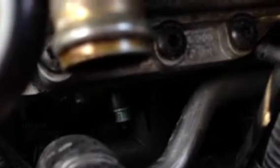Anyway, what you have to do is pull this stock hose out. Mine's still connected, I'm going to leave it in there. Your breather hose connects up top, so you have to slide this off. Slip this side off of the valve cover gasket, and then this pulls up off of this. So this is the one-piece tube that replaces the hard line. Keep in mind your stock hard line does bolt to the side of this head assembly right down here. See that naked bolt? Your hard pipe bolts to that, so when you pop off the bolt to take the hard pipe off, you just tighten that back up. You don't worry about anything else.